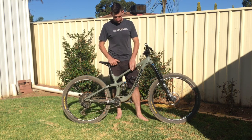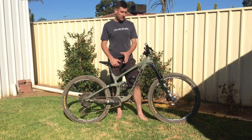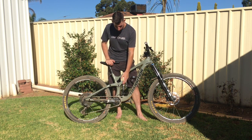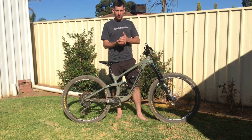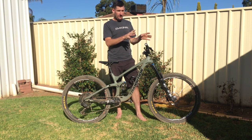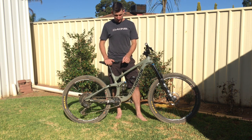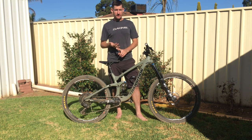If you asked me two weeks ago what I thought of this bike, I would have said it's good, but the rear end doesn't perform very well. The rear shock lets it down. That's what I've been saying pretty much from the start. Being that, I was kind of reluctant to go all the way to no spacers, because Transition have always - last year they brought it out with a 0.4, and then this year they've decided we need more ramp up, we'll go with a 0.6. But to me, it's worse. The 0.6 is worse - it's like they're already a fair way out of the ballpark of what feels good and compliant. And all the reviews say it's not a supple back end. I disagree. It can be supple. If you get the right setup on the rear shock, and the right rear shock in there, I think with the Super Deluxe it'd be more supple and it'll be as good as it gets. So change that shock out - it's going to be sick. It's going to be killer.